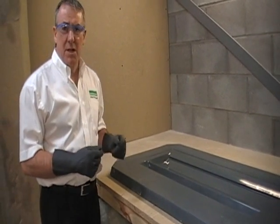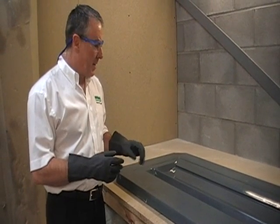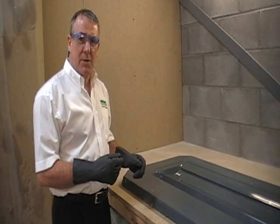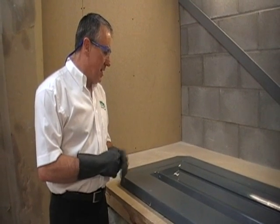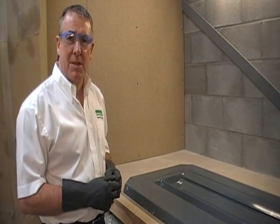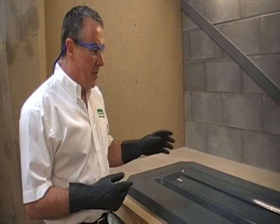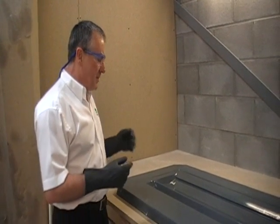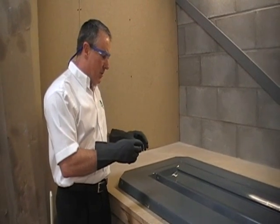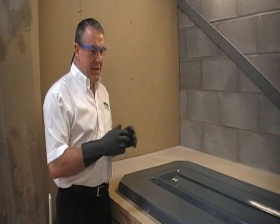Once that's dry — and the cure time starts from when it's dry — leave it for another 20 minutes. We want to put on a minimum of 4 coats and a maximum of 6 coats. After that, if you can leave it overnight you'll get about 30% more performance. When you've taken one moulding off, put another coat on; after the second one, put another coat on. That way any little areas that were missed or where it pulled off are covered.